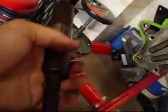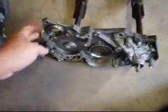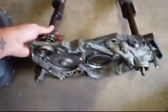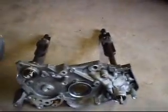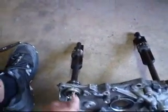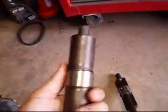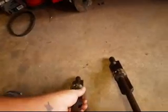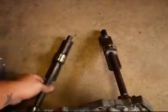Not much to it — I mean, it's a good, at least ten pounds. I'm not throwing them back in. In this casing I'm not reusing, actually, because it's broken up here. But this is how she sits in the motor — you got this guy, up on that side, and that guy over there. That's how she is in your engine. As the oil pump goes and the crank goes, it spins this one and obviously spins that one. There's your oil squirt hole, and your tabs and all.